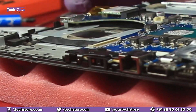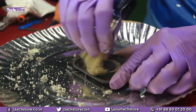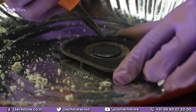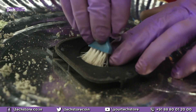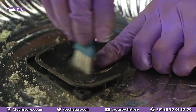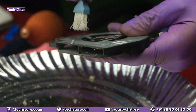This is the most important aspect — remove the fans. These are the two fans, the left and the right one. You can see how dirty they are and they need cleaning. Take the brush, put the fan on a piece of paper and start cleaning it. Use the hand pump, the air pump — give it as much time as possible for cleaning and you will see all the dust come off the fans. Do the same with the second fan too. You can see the amount of dust that exists inside — this laptop has been used for only around one and a half years and this is the amount of dust.